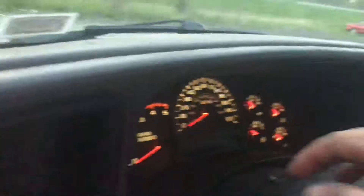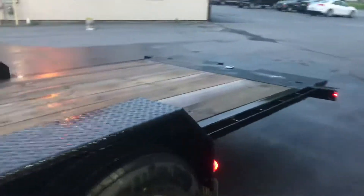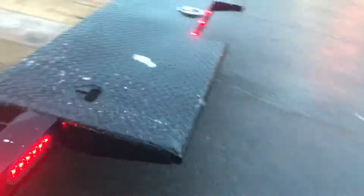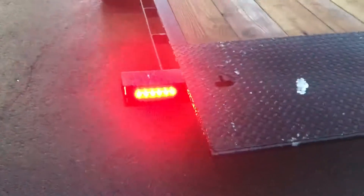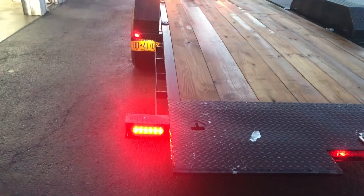The next thing we're going to do is go around and check our lights. This is fairly easy. You want to flip your parking lights and your four-way flashers — that's going to activate all the lights that you need to see. We've got marker light, marker light, marker light. License plate light is working, marker light, tail light. On trailers, brake and turn signal are the same light. You can see it lighting up bright when it flashes, but it's still lit when it's not flashing — that's how you can tell the tail light is working as well as your turn and brake.